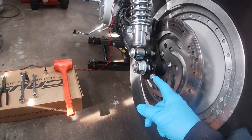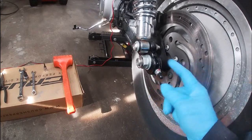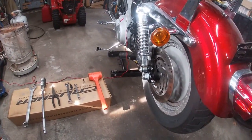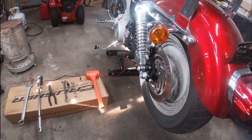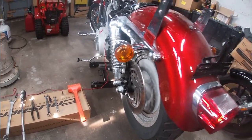I've marked it as I showed you earlier in the video — we're going to do three full turns on each side. That'll keep our belt alignment when we put it back together; we'll go three turns back. Generally three is enough, so let's get started.